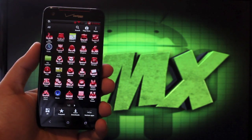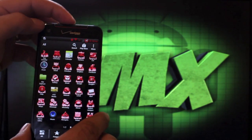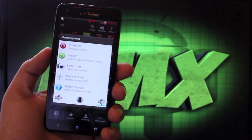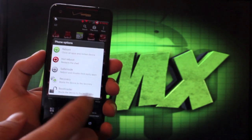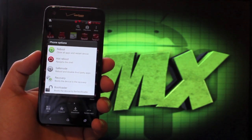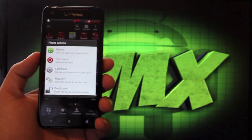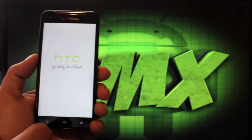We'll go ahead and install this. The way you'll want to do that is reboot into recovery — we'll hit the power button, and here we have a totally revamped reboot menu, so we can click Restart and Recovery. If you do not have a custom ROM already installed, you would select Reboot and then hold down the volume down button until the bootloader pops up, then choose Recovery from there. But we're just going to go straight into recovery.